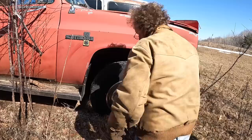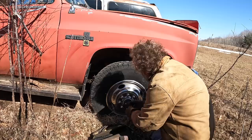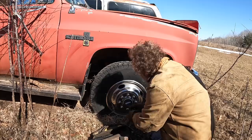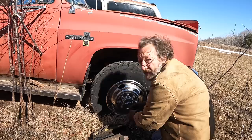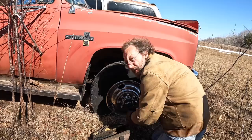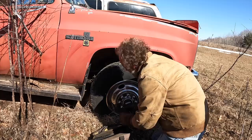So this time I brought a bag of tools with me. I suppose some of you are probably wondering why, because the wrecker is an off-road tow truck and very seldom sees the road, why I'm putting a lockout back in it instead of a drive slug. Well, it's because even though it spends most of its life off-road, there are times when we do have to drive it at speed. And I'd just as soon be able to unlock the front drive line to keep all of it from spinning while we're going at speed. Namely, because we have a Tom Woods offset U-joint in our front drive shaft in order to give me the clearance I need for the lift.